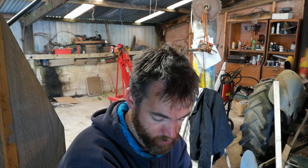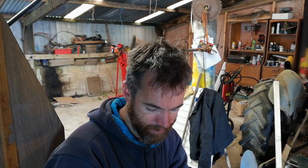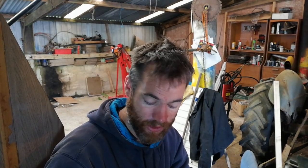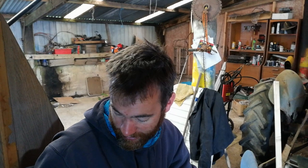Right, so that's great. At least we know now it runs. I'm not worried about the smoke and misfiring and all that stuff. It really is half rigged at the moment. There's no turbo plumbed in at all. The turbo actuator is lying there somewhere next to it, plugged in, but with no vacuum pipes attached. The mass airflow meter is lying on the ground, plugged in, but again, not recording anything.